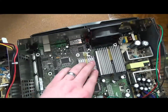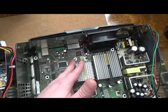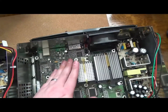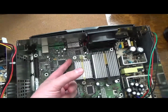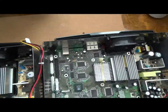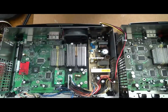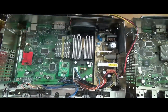What happens is if you take the 1.6 and put it into a case like this meant for the 1.2, there are metal tabs underneath the screws, underneath the motherboard. As soon as you put that board down and power on the system, it will short. I'm going to show you the fix to that.